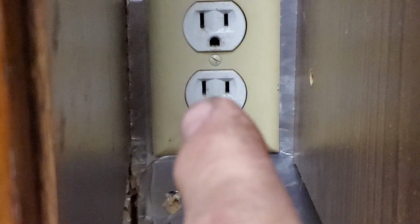So here we go. The power comes from the cord, extension cord from the outlet right there. And remember, the long slot on the left is neutral, and the right slot, the shorter one, is the power. So black is the power. The relay energizes. It's normally open. It closes. Then the power goes through here, and then the red right there, it goes red into the board. And then watch this black wire, still part of the 120 volts AC coming. It goes to here, around, goes up into here to all three heating elements right in there.